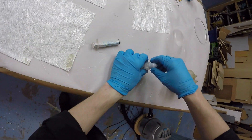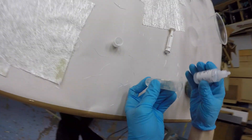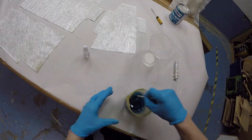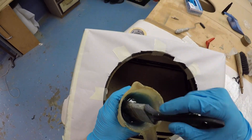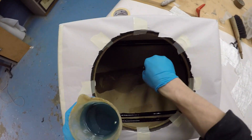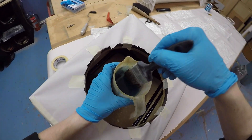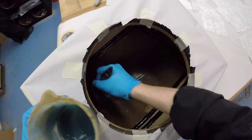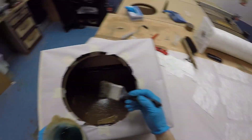Per Grant's recommendation I'm going to pour some accelerator into the lid then use the syringe to get exactly 2ml. Pour that in there — just a quick stir does it. You don't need to do it for ages, it doesn't change color. I'm starting to smell it, so that's a good sign. I'm hoping this first batch of 100ml is going to be enough to do the back wall. Let's be reasonably liberal with it — especially on the main section.